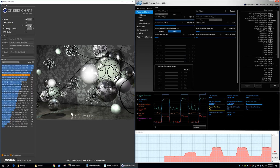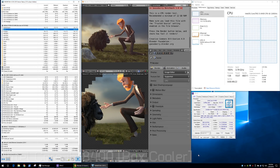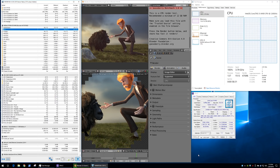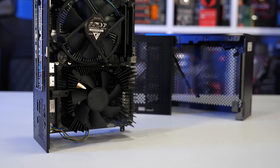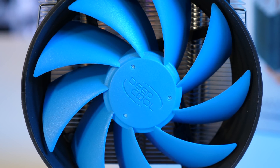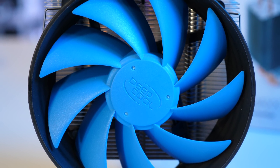At this point I started to wonder what the Core i5-8400 would do using the 95-watt configuration, so I threw it into the Desk Mini with the box cooler and ran some tests. The 8400 was able to maintain 3.8 GHz on all cores after an hour-long stress test and delivered the exact same Cinebench R15 multi-thread score as it does in our liquid-cooled Coffee Lake test rig. The reason was that the Intel box cooler kept the 8400 below the 82-degree threshold, maxing out at just 77 degrees. The next step was to reinstall the 8700 with a cheap tower-style air cooler to see if the box cooler really was the limiting factor.